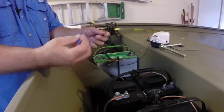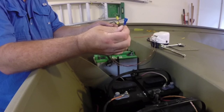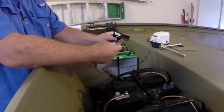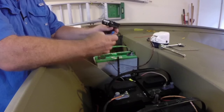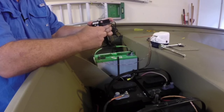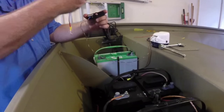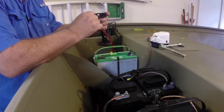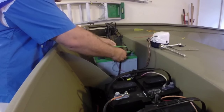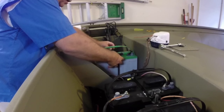I've gone ahead and done a little bit of work in advance — put my end connectors on for the battery terminals. This is just a slide-on clip that will go on to the bottom of the switch itself. In addition to that, I'll need a jumper from this side to the positive of the battery, so we're simply going to put this one on the on side. This is the one going to our battery and we just need to put our tray back in place.